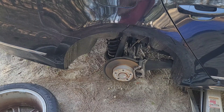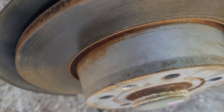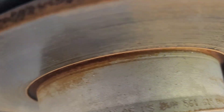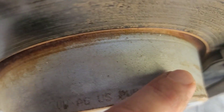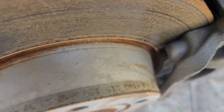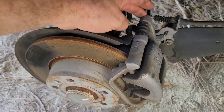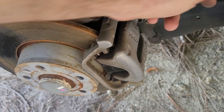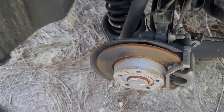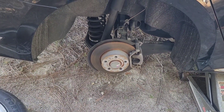Let's check the brakes to replace. These brake pads have very little left, as you can see. You could still use them — there's probably three millimeters or a little more — but I decided to do the job today because I have time. You're going to have to remove these two bolts, push it back, and put a new one. Let's see how to do it — it's really easy.